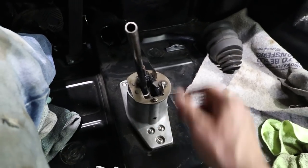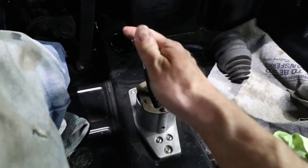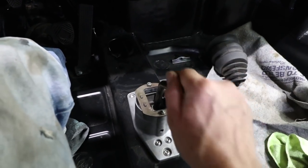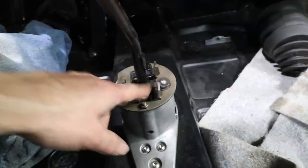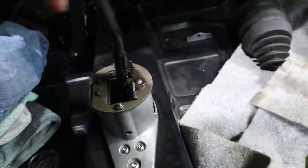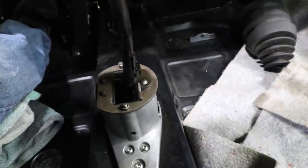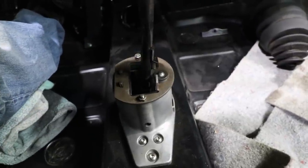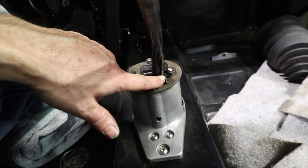Here's the same view at the shifter. This is neutral and it's up against the stop towards the driver's seat. So you just go straight forward for first, second, third, fourth, and fifth. This shift rod here is going to contact this lockout, and when this goes over, this comes up — there's some spring pressure here. As it goes into fifth, this lever goes on that side of the tank. Same thing for reverse — it knocks into that little tab there. Comes straight back and it's locked in place right there.